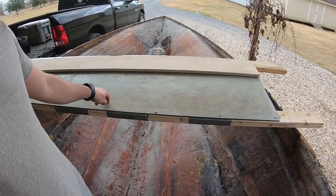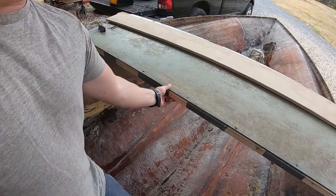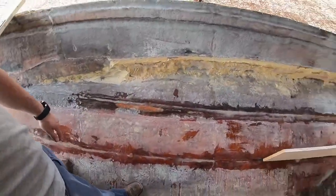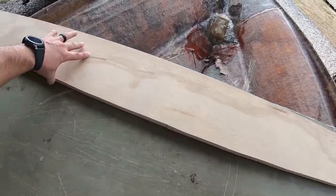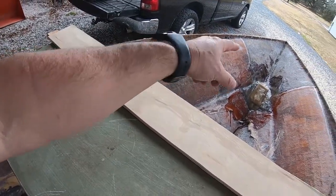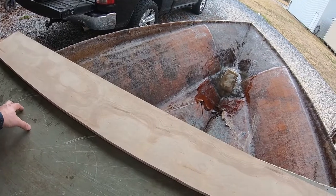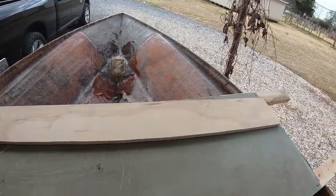One thing that I forgot to show you, I was having trouble whenever I was in the boat moving around, mixing resin and whatnot. So I had this old piece of plate fiberglass, and I put 2 2x4s underneath it so that I could slide this back and forth. It's a little hung up now, but you slide it back and forth where you're working so you can put all your resin. And I used it yesterday to wet out some triaxial here. I wet it out on the bottom side first, then I put it on top over there so that it would wet out a little easier.